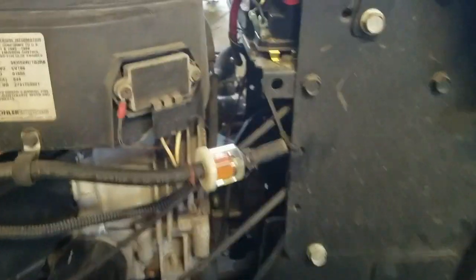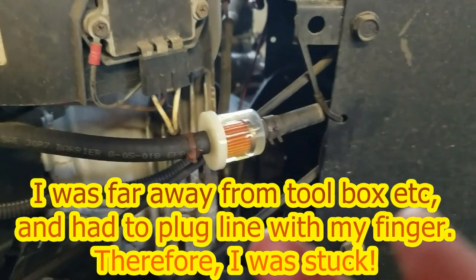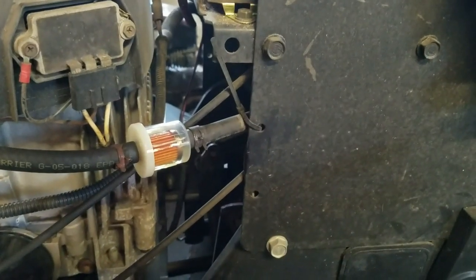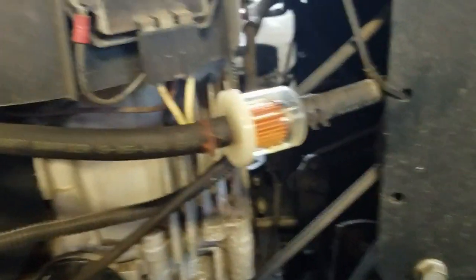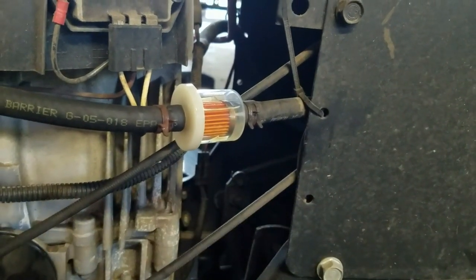One side note or word of caution: as soon as I did that and removed the air gun, water or gas started shooting out. I didn't have anything there to stop it. So when you do this, be prepared for fuel to come pouring out. I think it basically created pressure into the tank. Luckily I had something within reach and was able to slide it over with my foot to stop the flow so I could go get some tools. Just a word of caution — if you do that, gas will come shooting back out. I suspect it was due to blowing air into the tank, which created pressure and the pressure came back out.